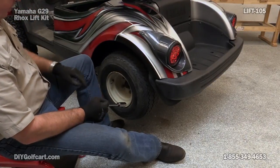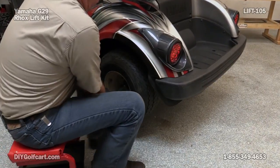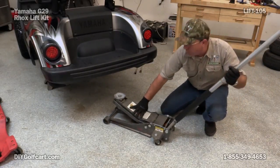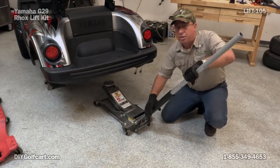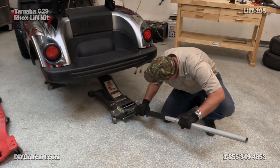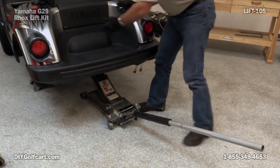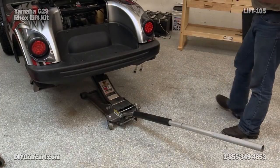I've got my brakes locked down. Let's get these nuts off the back so we can get these tires off. Now what we want to do is come in here with the jack and place it right underneath the rear portion of the rear arm, because what we're fixing to do is lower these shocks down. I've put just a little bit of pressure so that the rear arm doesn't drop when we drop these shocks. We'll remove this cover and next we'll loosen the shocks.